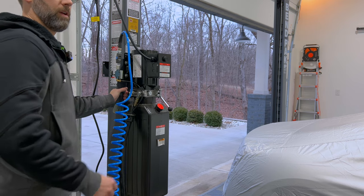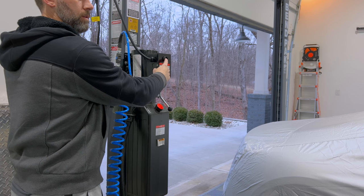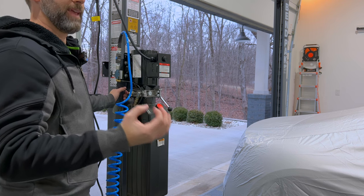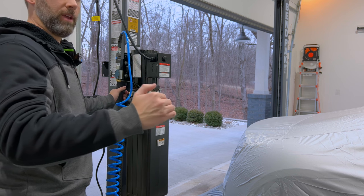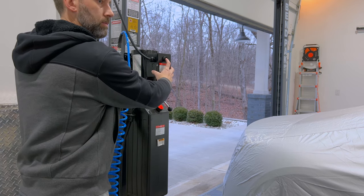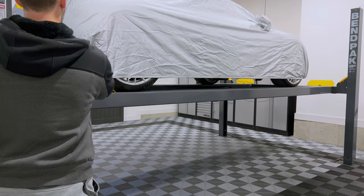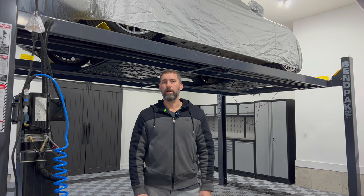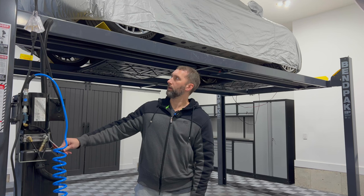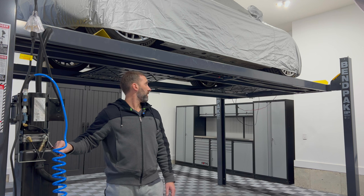Let's raise this bad boy up — it's a lot easier than coming down. You just press this power button right here. It's a little bit loud, but as it goes up you'll hear a loud clanking sound, and that's each one of the locks engaging. As it goes up and trips a lock, it comes out from underneath so it can't drop down. One final thing: after it's raised all the way up, use the lever and lower it onto the top lock to make sure there's no tension on the cables and it's resting on the actual locks.